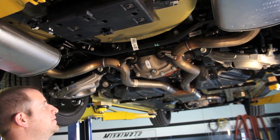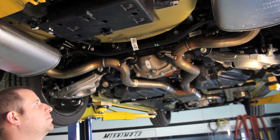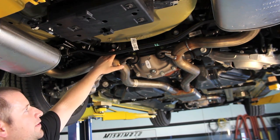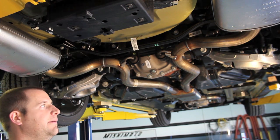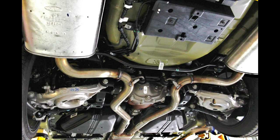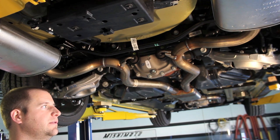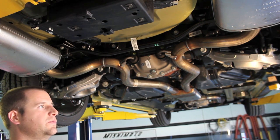I touched on the rear differential before — it's very big, very beefy. It's a four-point mounting system with two bushings up front and two bushings in the rear mounted to the subframe. A good upgrade is going to be replacing those bushings with either urethane bushings or urethane inserts to give you a little bit better traction coming out of corners, better shift quality, and a little bit less wheel hop.